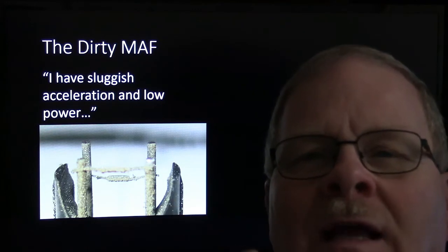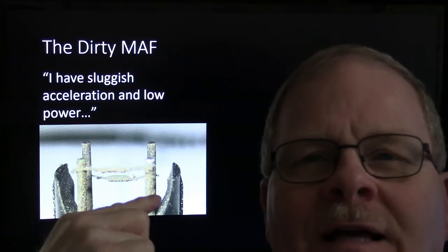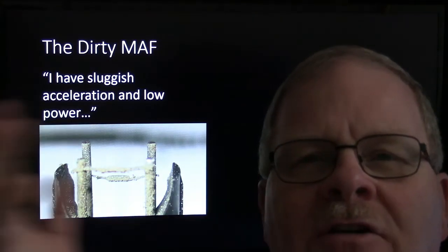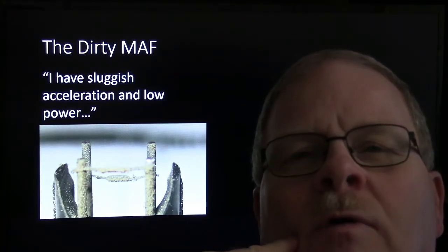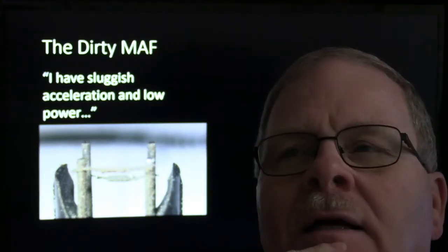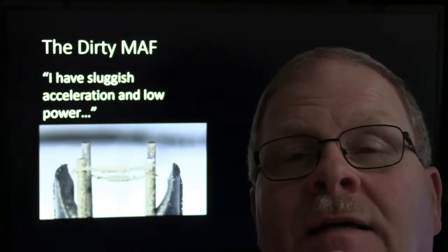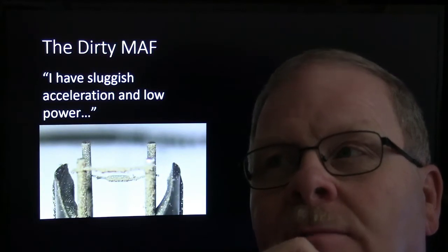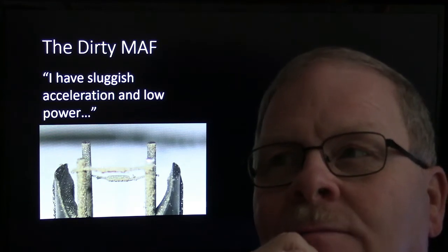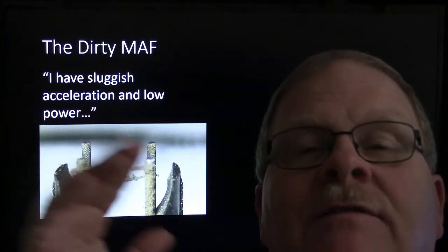And I says, I imagine that wing is probably jumping up there and getting on that screen right in front of these elements here, these platinum wire elements, and it's keeping the airflow from going through there. It's causing it to run really lean. And I said, so why don't we do this? Let's just get rid of this little roach's wing out of here because nothing should be between there, and let's see what that does. Well, he never had a problem again. He was happy as a lark. And you don't need to charge somebody $100 every time you open their hood. I was always sort of a diplomatic sort like that if I didn't have a lot of time invested in one. That was just, on a lark, let's just see if it'll work.